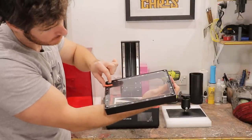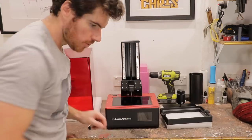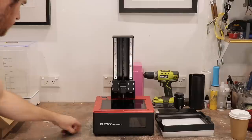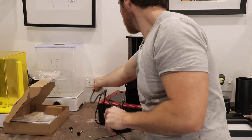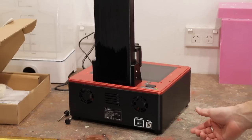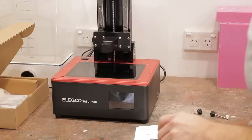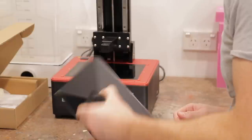Where are the instructions? Step one: take out the printer carefully. Take off the plastic film. Connect power cable to printer and power supply. Ideally I would permanently like this to sit here. Just want to show you guys the back — got the on and off switch, the power and the fans. We're going to pop the power supply in. Next step: please insert the build platform, fasten the rotary knob and loosen the screws — see picture one.